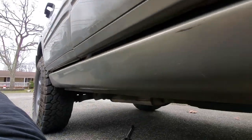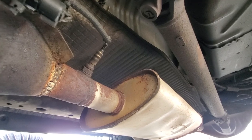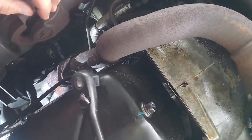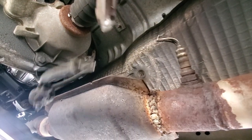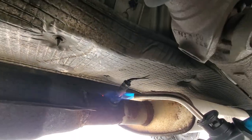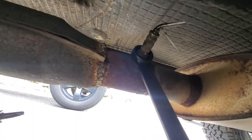We're just gonna lay down underneath the passenger side of the old General Grievous. About midway through, right here is our downstream O2 sensor. This is a lot easier to get to than the upstream. It's sure to be equally a bugger to get off, so I'm going to snip this cord, then slide on the old 7/8s and crank on this bad boy. First I'm going to apply heat with my favorite tool - good old torch. Not gonna use this wire anymore, so goodbye.